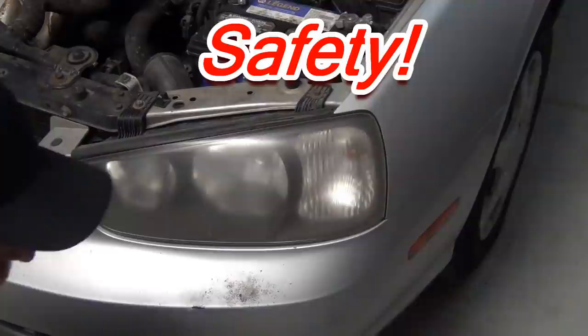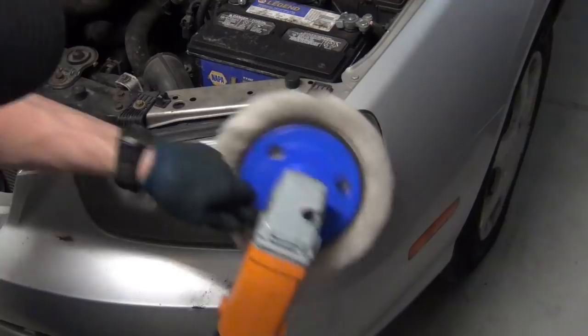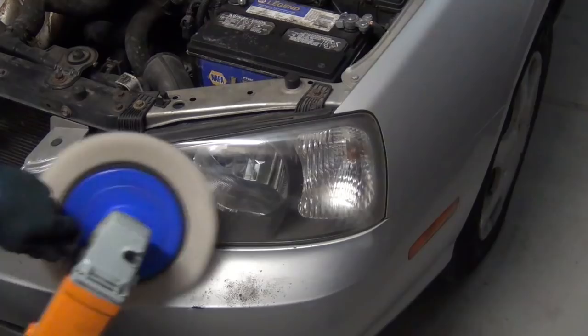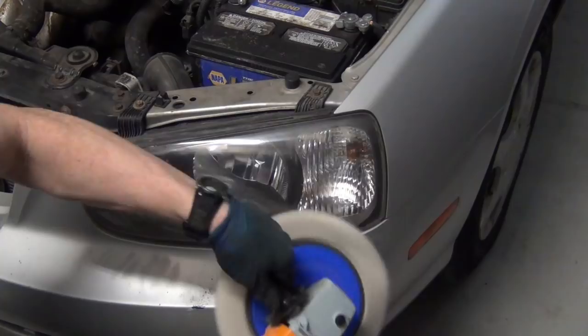Safety first. It's one thing to say safety — it's another to actually do it safely. I'm smearing compound all over the headlight without running the buffer yet, then I kick in and do the buffer — that's the first of three tricks. The other two: keep it moving so that you don't get stuck in one spot and burn a hole in it, and then manage your rotation.